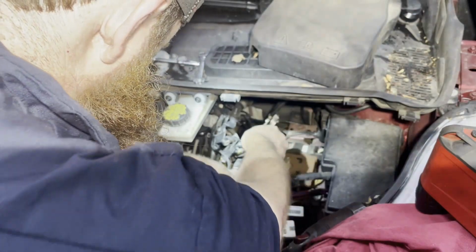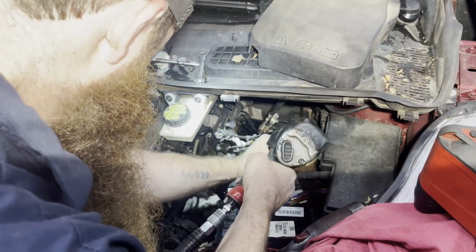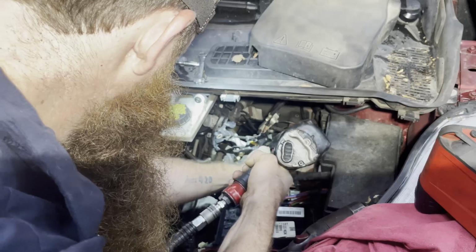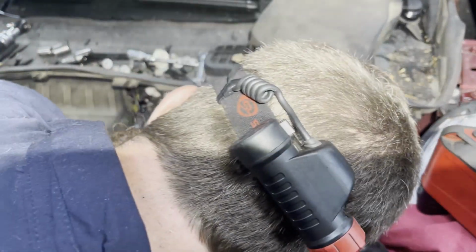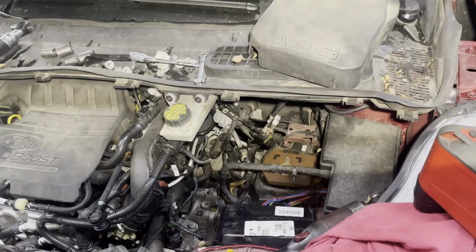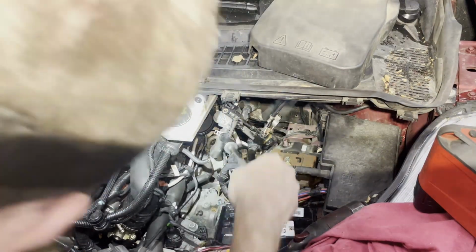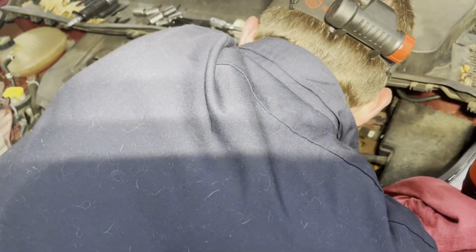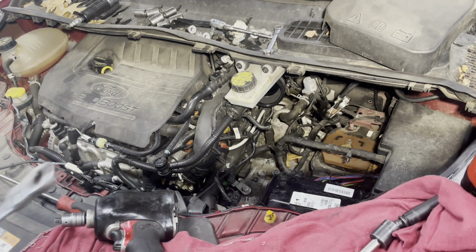Alright, now I'm going after this bracket on top of that cooler. I got the nut loose. Oh, the whole stud came out. That makes it easy. I got lucky. Still something secure in that. I'm gonna go ahead and try to get to the other one. Put my universal on my deep one for the back cooler bolt. All right, I bet a stud don't go back in there, because this is a pain. I'm just going to use a wrench to get it loose. Done fighting it. At some point, you're just going to draw a line and try something else.